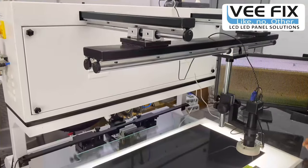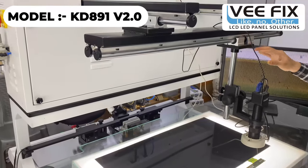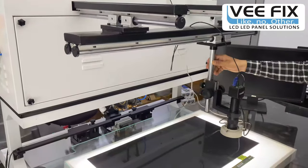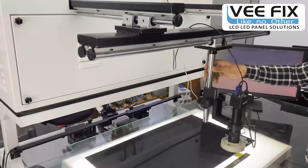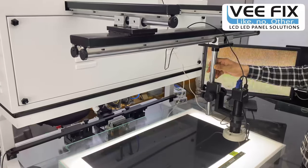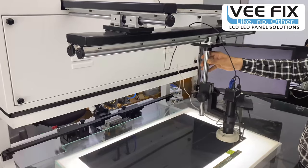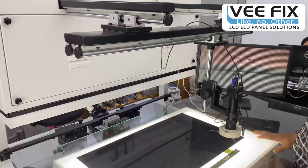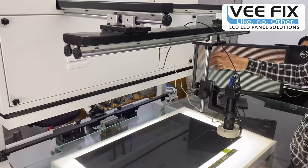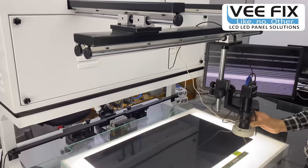Another very useful feature of our bonding machine KD891 LI version 2.0 is the moving microscope arrangement on the back side. You can move this microscope in the X and Y directions very easily, so you can observe the panel or object without moving the object itself — you move the microscope instead. A backlight and universal board are provided, so you can observe the glass slide tracks and the panel glass circuit inside very easily.